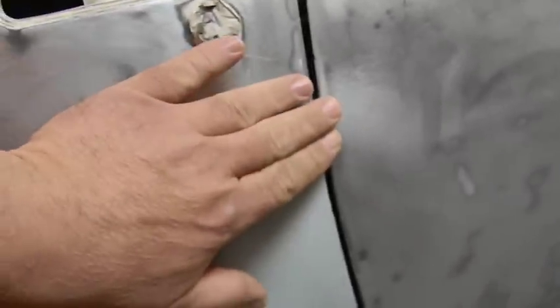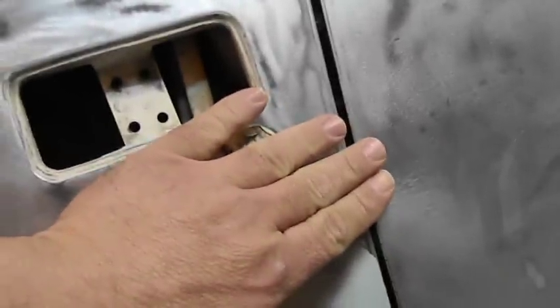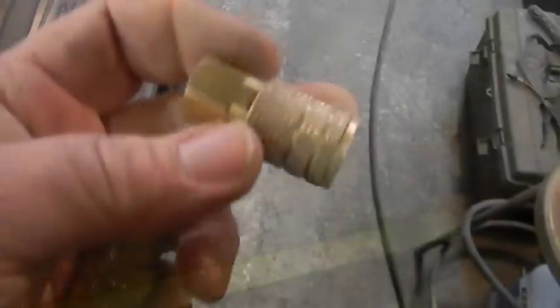I purposely have this door set in a hair to this door. So as I'm sanding this, I'm riding on this door. Or else what'll happen is every time I sand it, I'll keep wearing this to the end. Then when I'm done, I'll bring this door back out a hair to where it's supposed to be, and then I'll give it its final sand. And that's how I get it, the best I'm going to get it, at least. So, give or take, with that said, guys, I'm done gabbing. I'm going to start tapping.